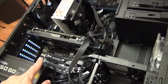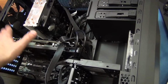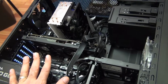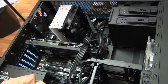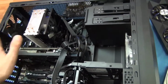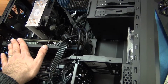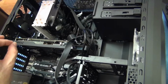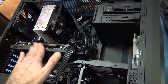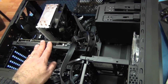There have been some interesting advances with motherboards over the years. In this case, we have a dedicated graphics card, and of course we have the CPU and so on. What's happened with modern motherboards is they've added more features to them. If you just wanted a very simple computer, you could probably, in many cases, get away without this, because the motherboard would have its own little graphics chip built in. But just be aware, it would not be at all powerful enough to drive modern day virtual reality, which is why you need a graphics card by AMD or NVIDIA.